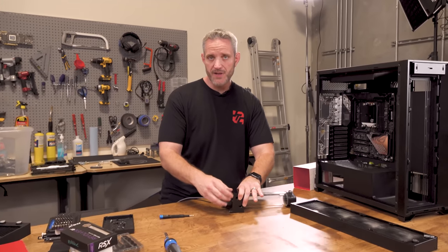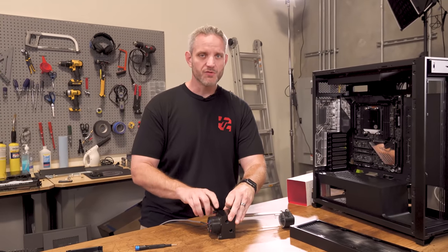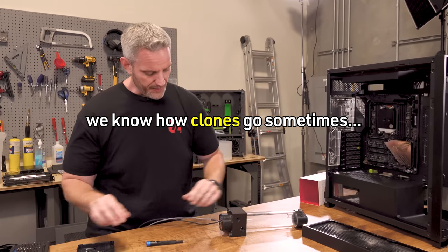I think that's some sort of drawback of the VPP pump, because I have seen so many people — including Paul's Hardware — complain about the quote-unquote failure rates of these exact pumps. I just think that's what's happening: they're getting gunked up. People aren't actually opening them up and cleaning them when they do these complete system flushes, which is leading to that particular failure. I can't blame them for being mad; I just think there was a little bit of lack of understanding this particular pump's drawback because it's not a D5 — it's basically a D5 clone.